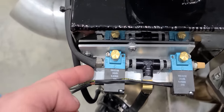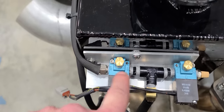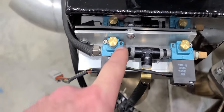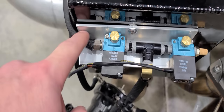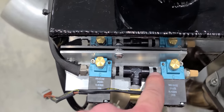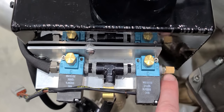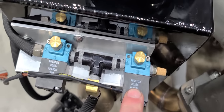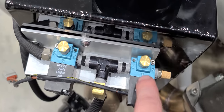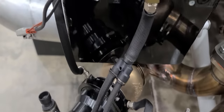This is two three-port MAC valves from Holley. We've got an inlet coming into the fill solenoid on port number one, and then it's bridged across to the vent solenoid. The output to the wastegate is right here — CO2 in on port number one, bridging the two together. We've got the vent over here so that if we activate the decrease solenoid we can remove pressure. If we don't activate it, it stays shut and doesn't leak off into the atmosphere.